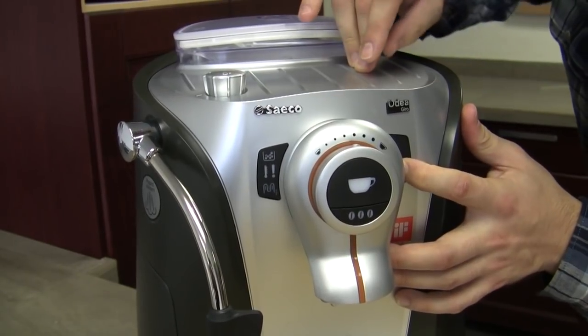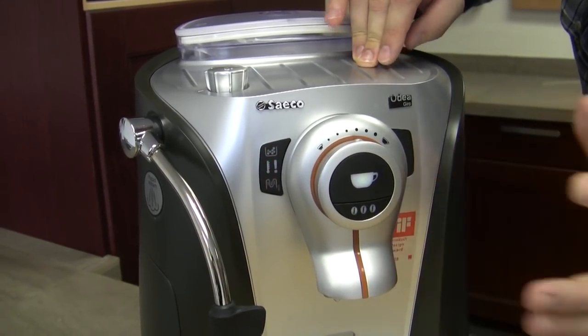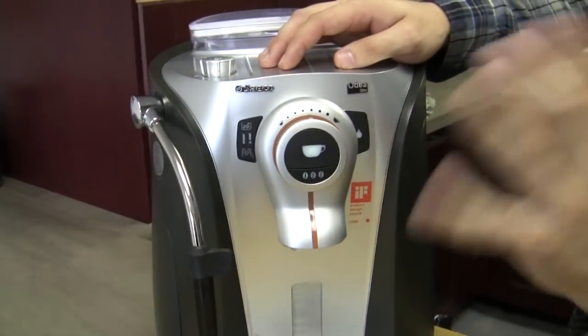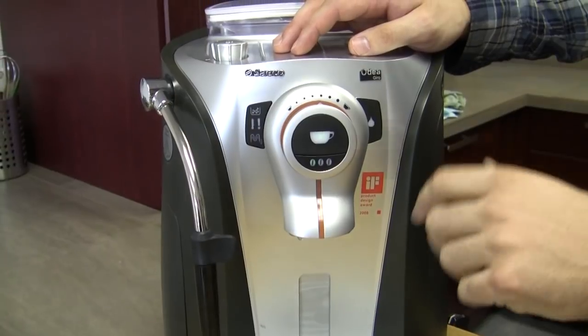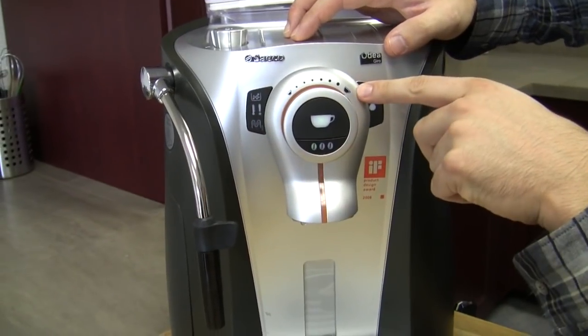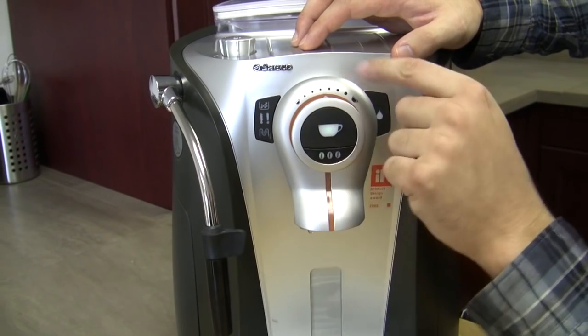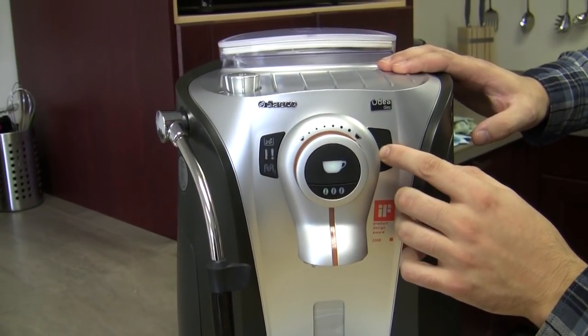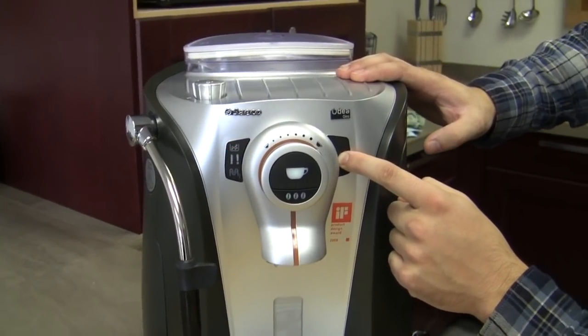So here we go. I'm still holding it down just to know for sure — and there we go. Looks like it's counterclockwise. I was wrong. So I'm going to let go and now we are in test mode. There's nothing really here to let you know, but you'll know as soon as you start pressing buttons. So essentially you have six functions that you can test in test mode and you can go into each of those functions separately. Now pressing this — that's my brew unit moving. Right now we just found out that our brew unit can go from home position into work position just fine, that our brew unit motor is working fine.